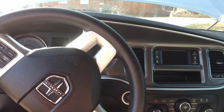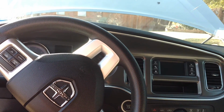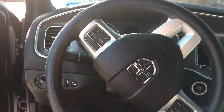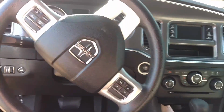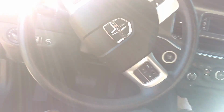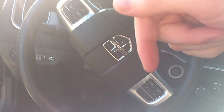Alright, ladies and gents, we are at the point of checking the fluid level. You can't check it in park, so what you want to do is put the parking brake on, start the car, put it in reverse, make sure your car doesn't roll. This is the NAG1 specific dipstick. I'll put a link for it in the description down below.